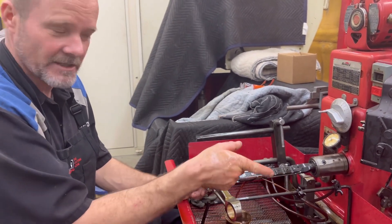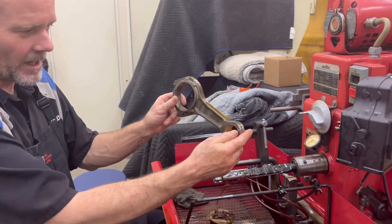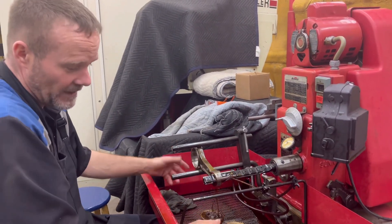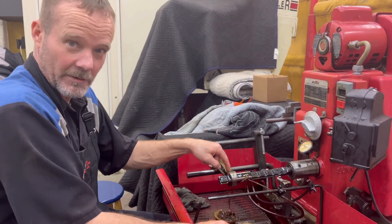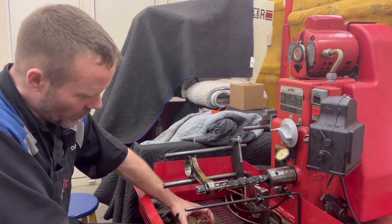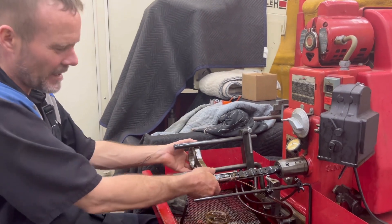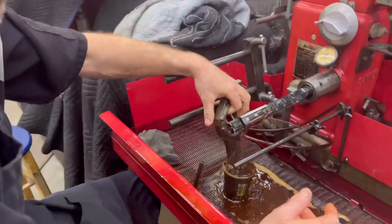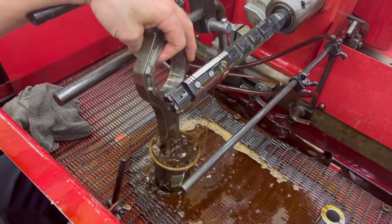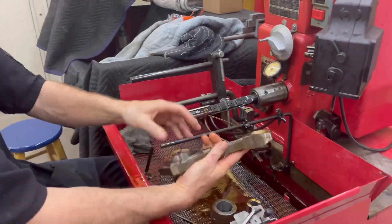The first one we ever did two weeks ago was with rough stones — we cut it way too big. I had a rod with a new bushing in it that we cut too big. But I was getting a feel for it; I didn't care about that rod, but I don't want to do these over. The first one, fine — throw a new bushing in it and hone it out. In hindsight, we could have just done an old bushing. It's all hot, so keep a cup down there underneath it so it catches all of it — got a little reservoir and I can dip that down in there and kind of cool it off.